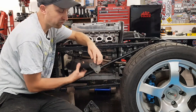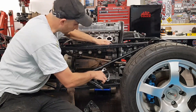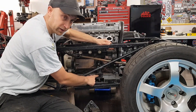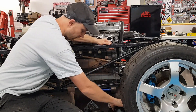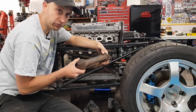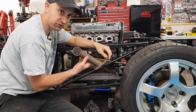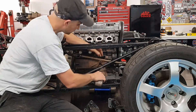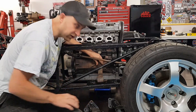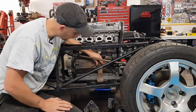My original plan was just to cut off these flanges and weld Vauxhall ones on, so it lined up, bolted on, and you've got your rubber mount here. But on the off chance, I dug up my old engine mounts that I made for my rear wheel drive Astra about 12 years ago, and these line up with the holes and fit almost perfectly to the chassis.